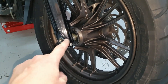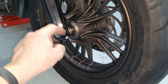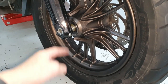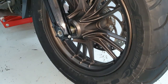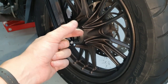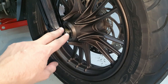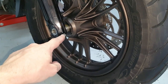And if you are the guy who sprayed these rims, why didn't you tape off the inside? You oversprayed and then you put the bearings in there. You know what sort of super glue that makes? 5-pound hammer plus an extension rod. Once I was done, you had these hairs of old paint coming out with the bearing as I scraped the side. So I took 400 grit sandpaper, cleaned all of that out and pushed the new bearings in.